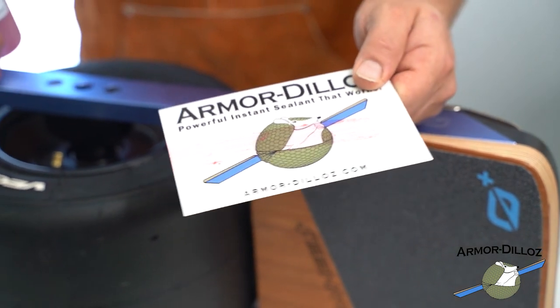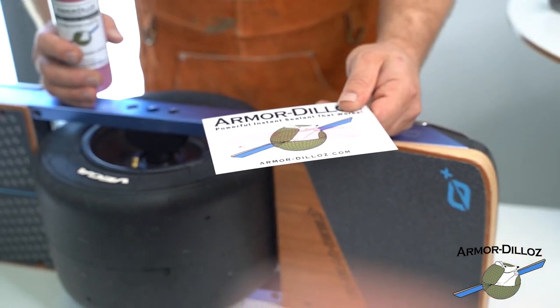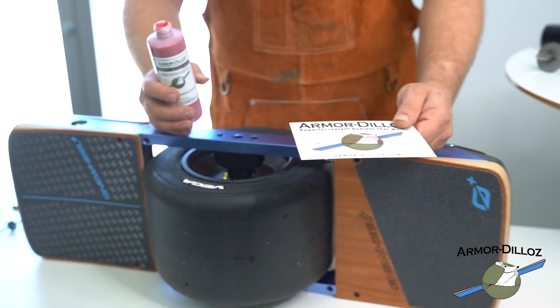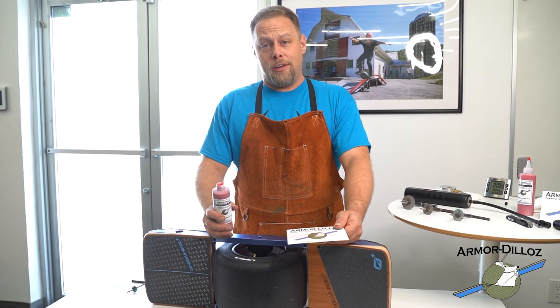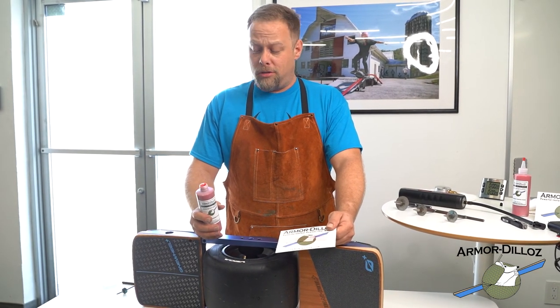Now, that means a couple of things. Number one, getting it out of balance is pretty darn hard to do because it doesn't stick inside of it. And secondarily, maximum product is available to the tire at any point where it's punctured. There's basically this material moving freely inside of the tire, so a large amount of it can get to any area where it needs to be sealed.